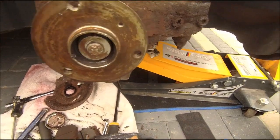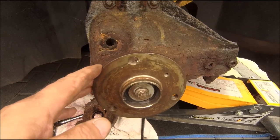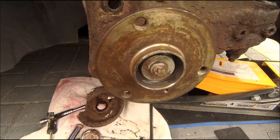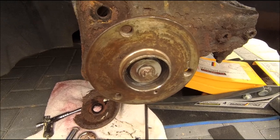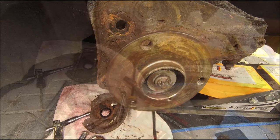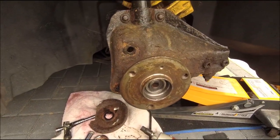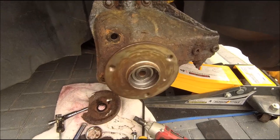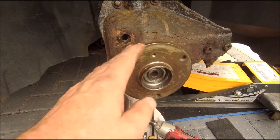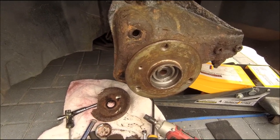So, took it off. I noticed somebody used copper grease before in there, which is not the grease to use, so I put some lithium stuff in there. As you can hear, I thought the bearings all seemed okay. It ain't okay, so it's a new one. I've got a new one ordered, but it's not going to be here till next week. So this one ain't going to get any worse. It's got plenty of grease in there now, and the right grease as well. But I'm not using the car that much, so it doesn't really matter too much.